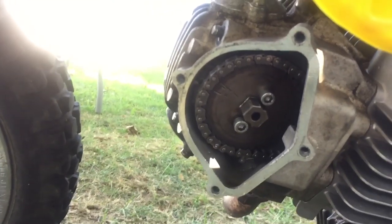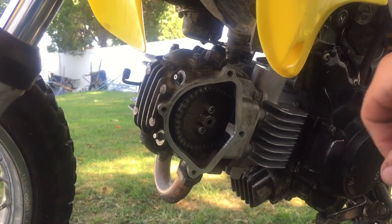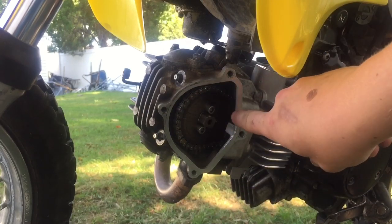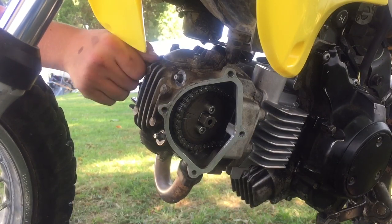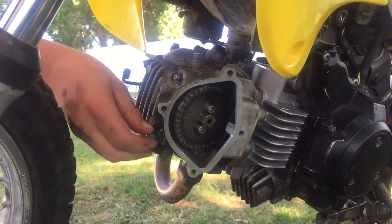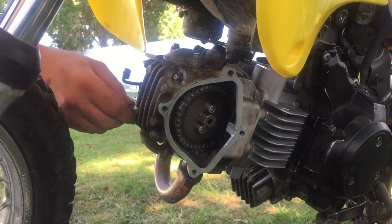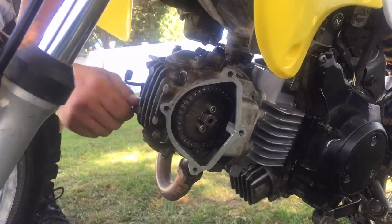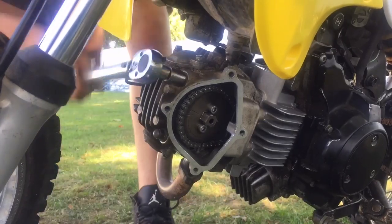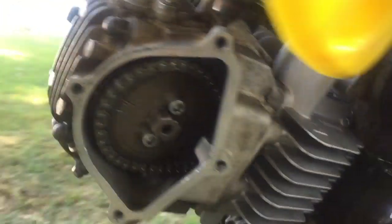The cam is on and now we have to torque it with the torque wrench to about 8.5 ft-lbs. Not too much torque but still got to torque it to make sure everything's right. To make tightening down the cam easier, I'm going to put on the four head bolts and torque them down to 16 ft-lbs. I just torqued down the cam bolts. Now I need to put on the cam tensioner.